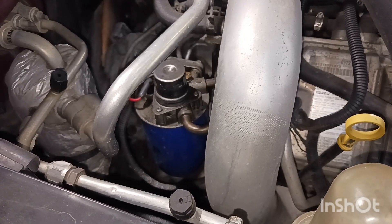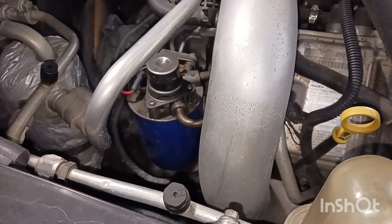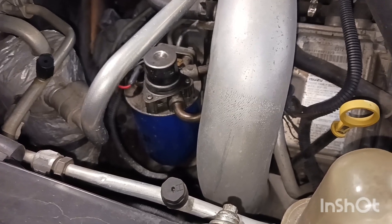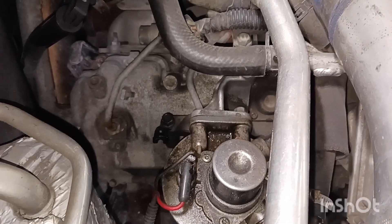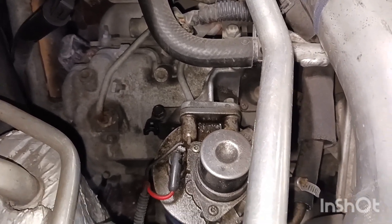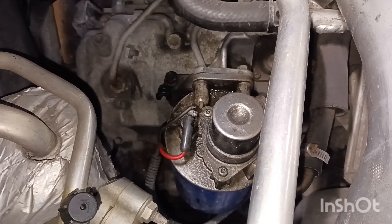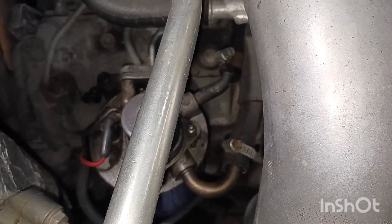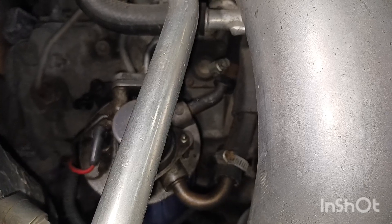There is your fuel filter housing slash fuel primer. You are going to want to remove the filter before you take it off — it just makes it way easier. There are two 13-millimeter bolts, though this truck only has one of them in there. Take them out, you have a small ground wire and a small connector for the fuel heater, then you're going to have two fuel lines — a feed and a return. Take them off, pull your part out, and get it to the bench.